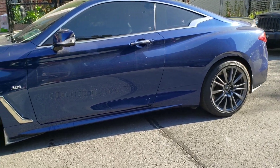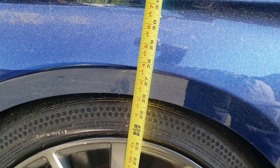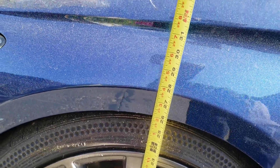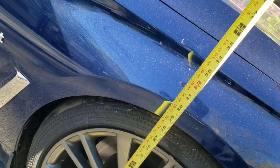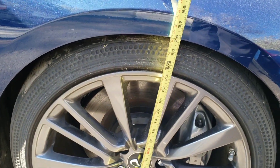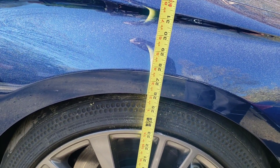The car's now on a flat surface and I'm going to do some quick measurements. The first measurement is about 26 inches. Remember, the front from factory was about 26 to 27.5 inches. Let me check the next side — this one is also right around 26. So we're going to try to bring this up at least another half inch, maybe three quarters of an inch.